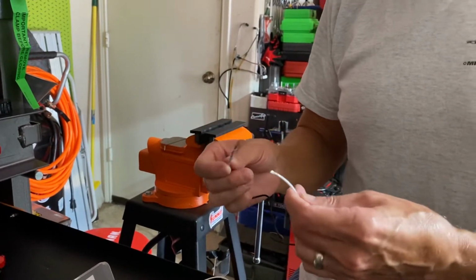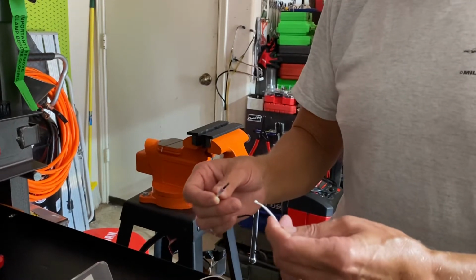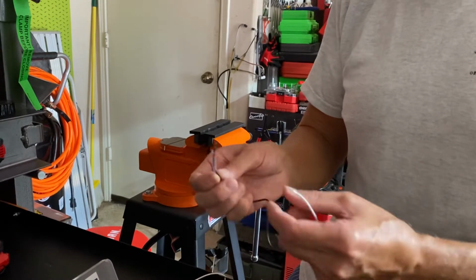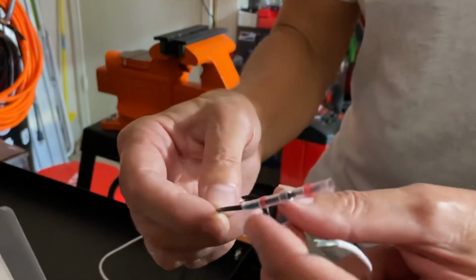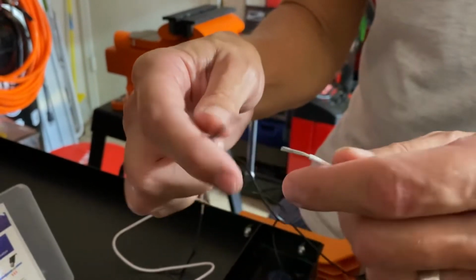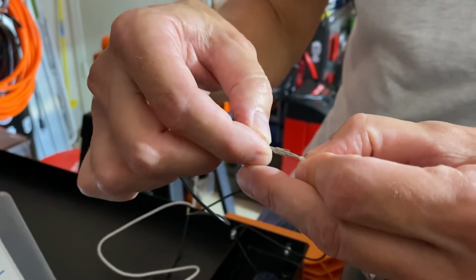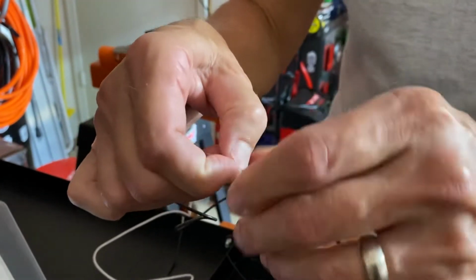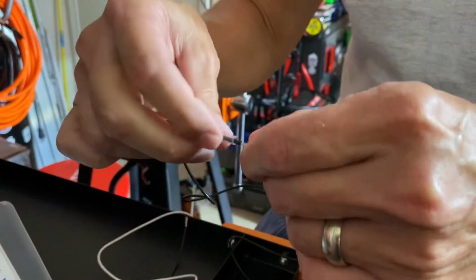But for example, if you have wires in your fuel injector that get eaten through by rats or rodents or whatever, and you've got to fix them, these work really good. So what I usually do is I slide it through first if you have enough room on the wire. Then I take the wire on this side, and I try to get the wires to interchange between each other, kind of like fingers going through. Then I just gently roll the wires over like this.